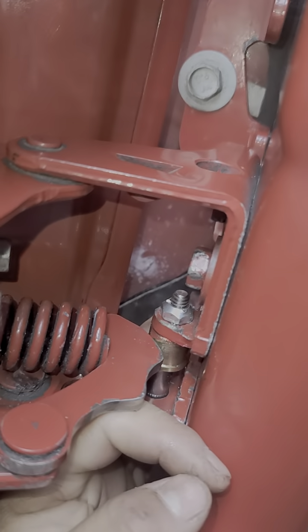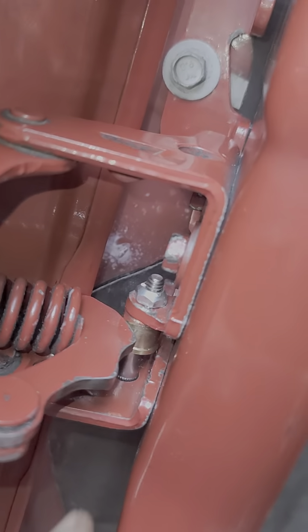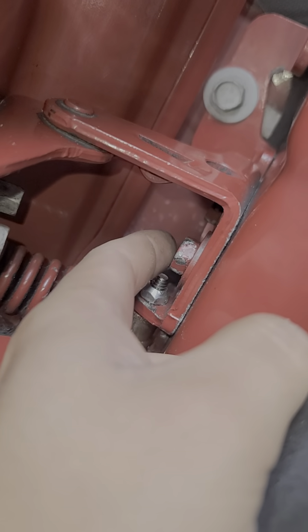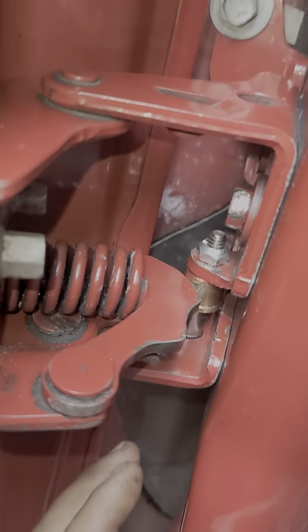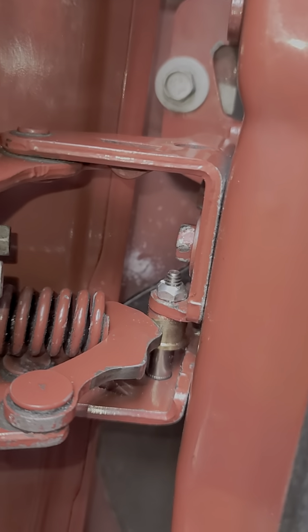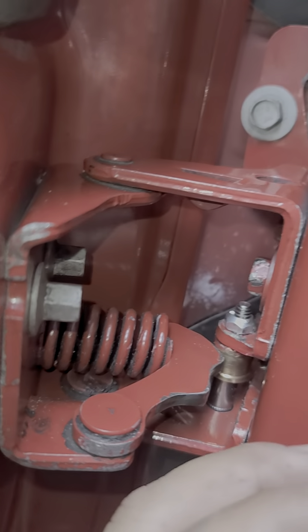Both middle fingers reaching in and barely tightening it. Once you've got that one in there, do the same thing for the back one, but don't tighten anything yet. Once you've got those started, go ahead and tighten up your top one just a little bit — leave it just hardly snug so you can then tighten these two and move this door up and down if you need to. Once you've got those two tight, go ahead and let off your jack and swing your door back around. Do the bottom rear, then swing your door open again and do this one.